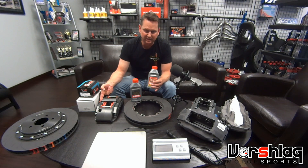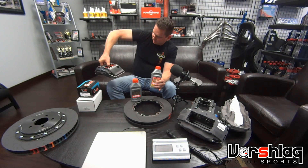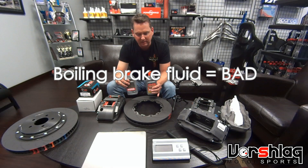If you do any sort of testing and you're pushing the limits of your brakes, these temperature strips will tell you if you're maxing them out. These go up to 480 degrees. If you're maxing these out, you probably need to be on 660 or SRF.